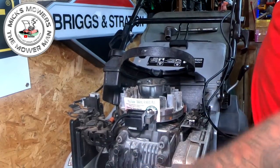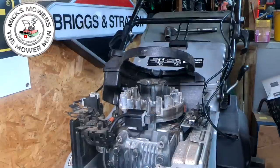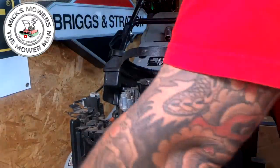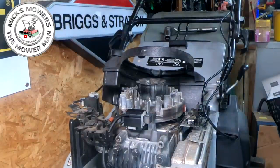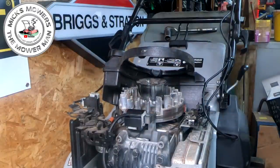So that's all you have to do. Just remember two things: remove your HT lead whilst you're working on the machine, and then rotate your business card out from the coil — keep that card because you want it for next time. So now I have a coil fitted. The wires have been tested for continuity. I'll keep hold of the old coil and check it another day. But personally for 20 pound, let's just move on. This machine is from around 2012, it's been commercially used, so a new coil is also a good selling point — brand new ignition module just fitted.